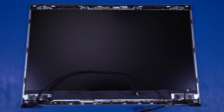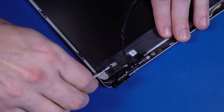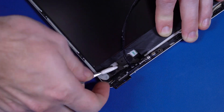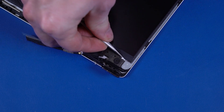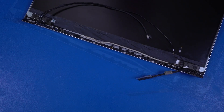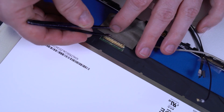The display panel is held in place by two strips of stretch-release tape. Grasp the pull tab of one of the strips of tape and carefully wrap it around the end of a tool, such as a pair of tweezers or a screwdriver. Slowly twist the tool to release the tape. Continue twisting until the entire strip has been removed. If the stretch-release tape strips are pulled too quickly or at an extreme angle, they will break before releasing the display panel. Note: the removed stretch-release tape is not reusable. Remove the second strip of tape in the same manner. Partially remove the display panel cable from the routing channel on the display enclosure. Lift the display panel off the display enclosure and turn it over to gain access to the display panel cable connector. Peel back the retention tape and disconnect the display panel cable from the connector on the display panel. Remove the display panel.